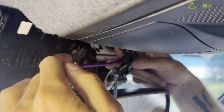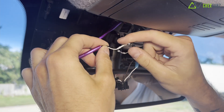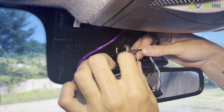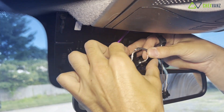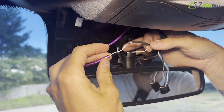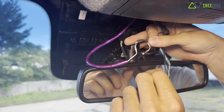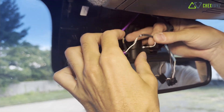Here's the RCA cable that goes back to the back side of the new head unit. We've got a black and a white coming out of that RCA cable. The factory harness splits out under the shrink wrap into a white cable and a black cable. Our RCA happens to be opposite, so we actually had to run black to white and white to black. When you splice those together, check your head unit — it might be a little fuzzy when you put it in reverse. A good thing to do is quickly connect these, test it, and make sure it's working properly before permanently installing it because you don't have a lot of slack and only get a couple of tries.